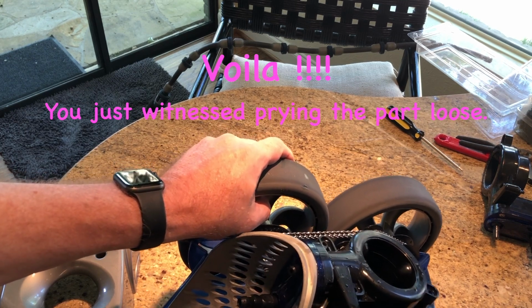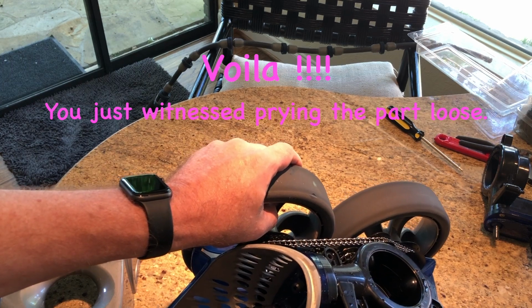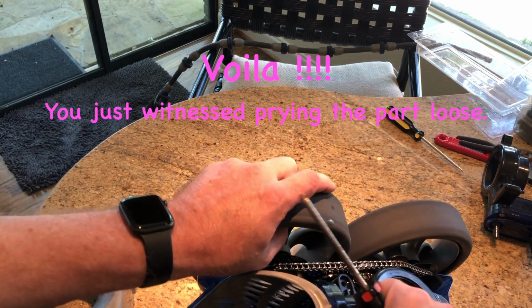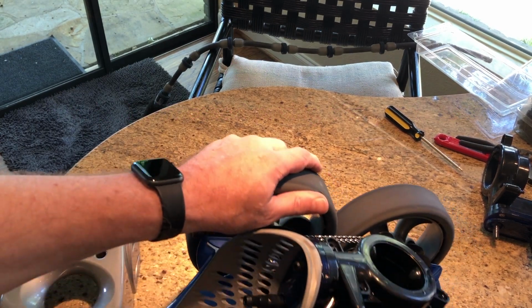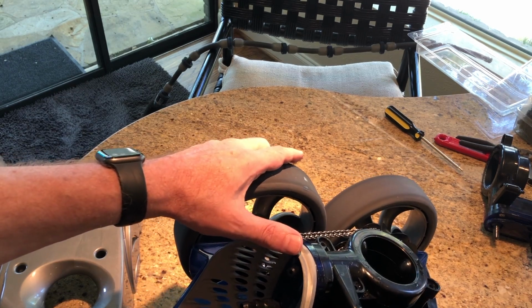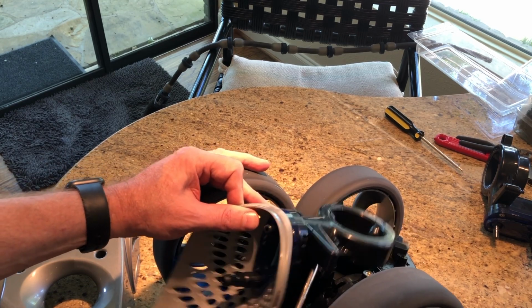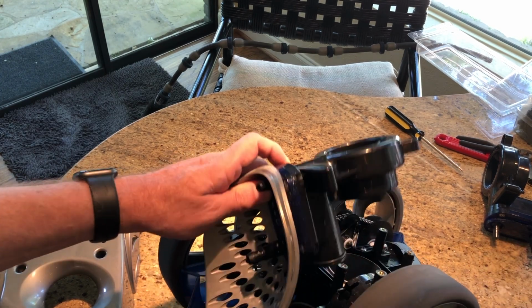After yours has been in the pool, running around for years or whatever, that O-ring is going to have seated strongly in there. It probably feels like it's glued. So you're going to have to use a screwdriver and pry here, a strong one, prying underneath this. Don't get out here on this outer. Get your screwdriver up under the main portion of the body, or just any place.